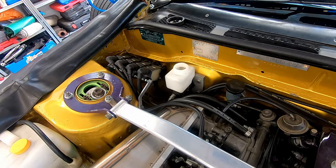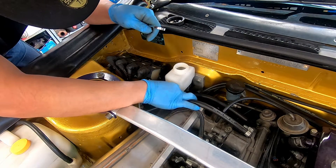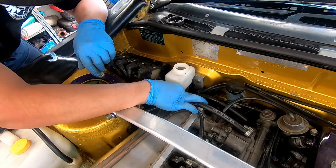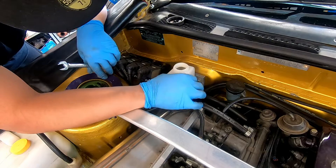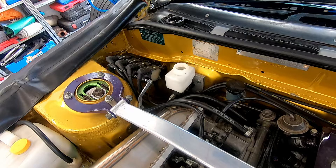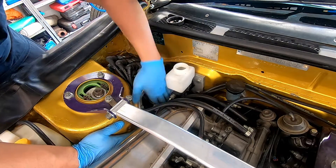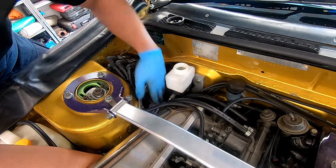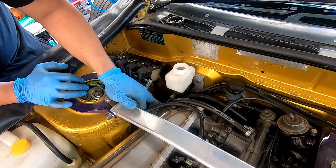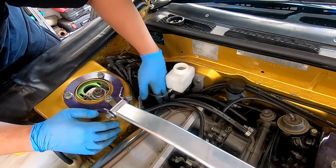The easiest solution is to use a booster delete plate with the standard master cylinder, so you retain the tandem master cylinder circuit and all of the stock brake lines. This means if you bust a brake line you'll still have brake pressure at one front wheel and at least one rear wheel. The best delete plates we've seen are from Home Developments, as they already have the pedal ratio correction built in. Since I changed to the single compact master, there's only one line coming out, running to a distribution block and then to a proportioning valve for adjustable front-to-rear brake bias in the cabin.